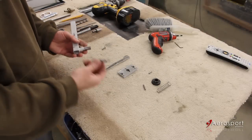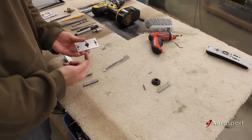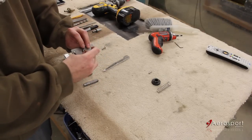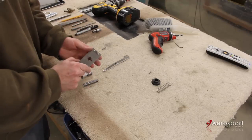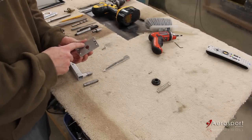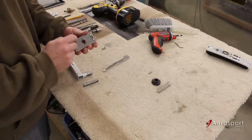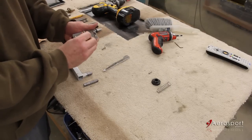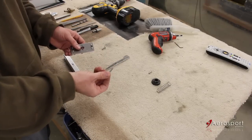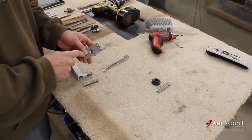We have our handle and inner pin cut down to the proper length. Next, in order to give the lock arm something to grab on — when you lock the cylinder, it's actually going to put a little arm over the door release pin here. To give that a better bite, the kit provides a longer pin, but that also means you'll need to notch out this inner plate here. This is the pin for the safety interconnect. When you push the button on the handle, it raises this pin and allows it to turn. We're locking the door by preventing that pin from lifting up. Take the pin from the kit, set it in here, figure out how much bigger you need to make your slot, and then just work on that with a file.